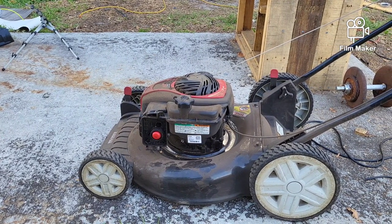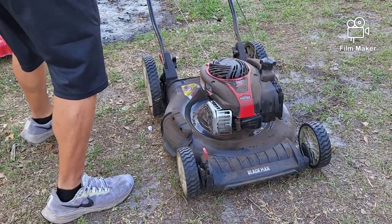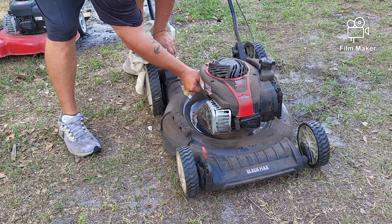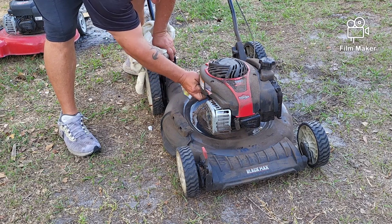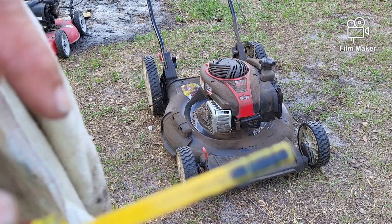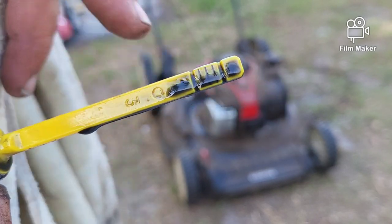But let me show you that I can make it stop smoking. Now I have my dipstick — I just cleaned it off. Let's put it in. See how much extra oil there is in this thing. I have a feeling we got a valve up here that's probably loose and needs to be adjusted. That'll be a separate video. But for right now, I want to show you that it's well above the line. You see this line right here at my fingernail? That's the full line, and we are at least 30% too much.